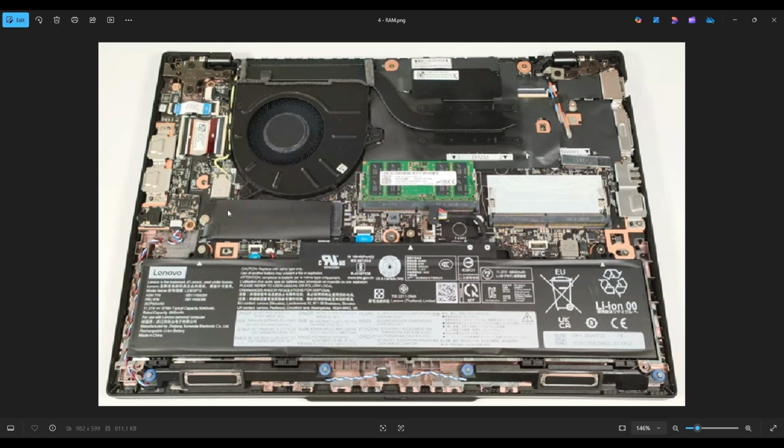The way to operate this, there's a single screw here on the left. After undoing that screw, the solid state drive will release. You can then pull it to the left out of this port right here. There is a cooling pad underneath that solid state drive to help with heat transfer. Make sure that stays down. You don't want to remove that thinking that it's not needed.